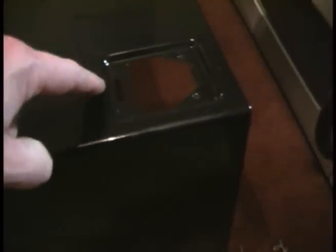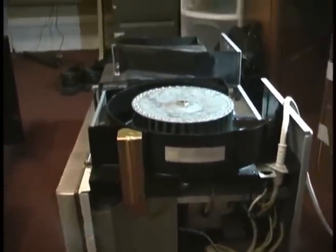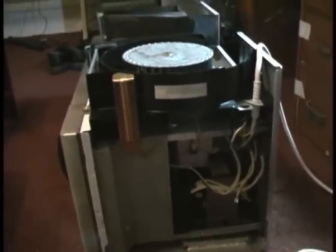We've taken the cover off. There are several screw spots here on the top — remove all the screws on the top and the cover plate. You also have to get the screws in the back, here and here. And there are usually some screws underneath the microwave. Once you get all these screws off, it just comes off like a shell, and leaves you the microwave itself.